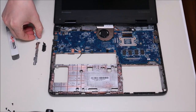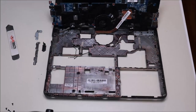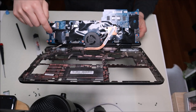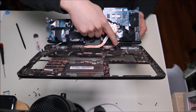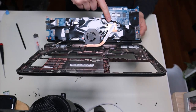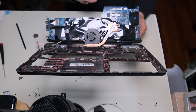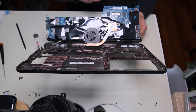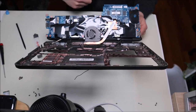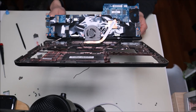Make sure to keep all these components off to the side so you know how to put them back together. Now you can grab the motherboard here and lift it up. You can see cables running from the power board, the LCD cable, and the fan attached to the heatsink assembly over your CPU. Keep in mind the CPU is integrated into the motherboard and cannot be easily removed — so there's really no point going at that unless you want to apply new cooling paste. These cables — this one just pulls up on the black tab, same thing with the other. The power port pulls right out and then your motherboard will be free.